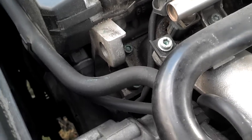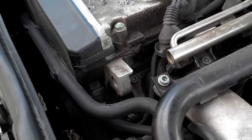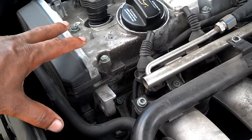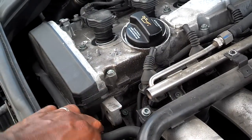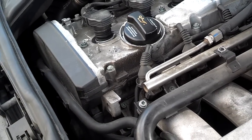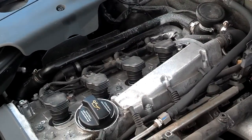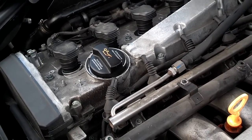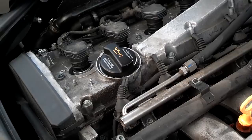That may be six inches deep, or 12 inches deep. However long that is, that's where it mounts to the block. Once this car overheats, this aluminum will deform when it heats up and cools down. There's a seal in between this head and the motor block. When that head deforms, it'll cause some warping action, which causes the head gasket to allow combustion air, oil, and/or coolant to transfer into different chambers that they don't belong in.